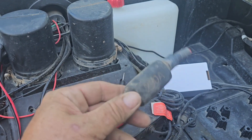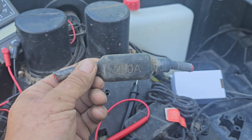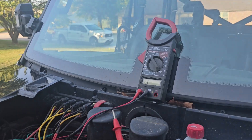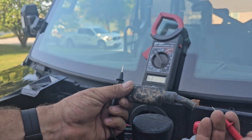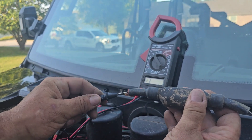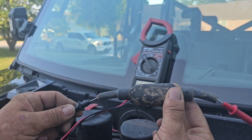I've got that fuse cut out and I'm just going to do a continuity test to confirm that was it. If you see here, there's a connection. So now I'm going to take my old fuse and see if I got continuity - and I have nothing. So that for sure was the problem.